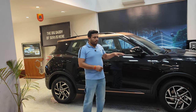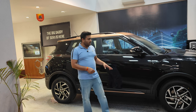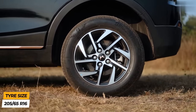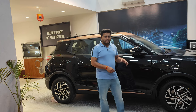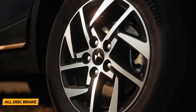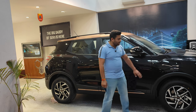Looking at the side profile, the tires are on dual-tone diamond-cut alloys with a specification of 205/65 on 16-inch rims. The front suspension is MacPherson struts with an anti-roll bar. All four wheels get disc brakes, along with EBD and ABS.